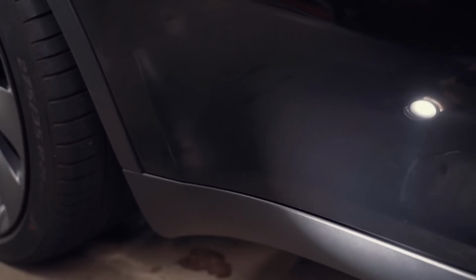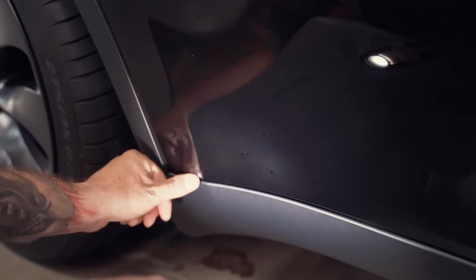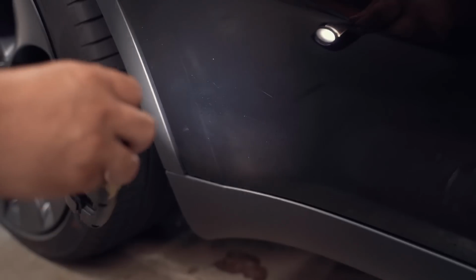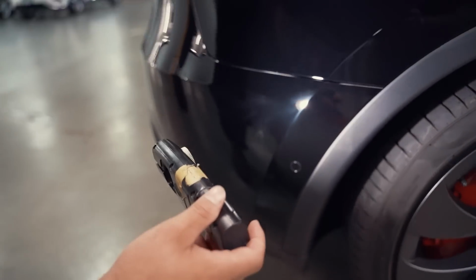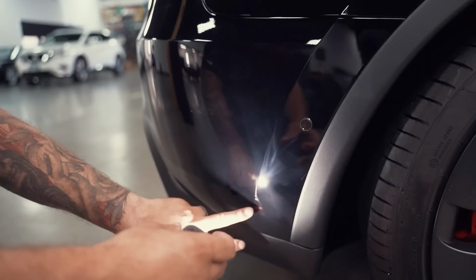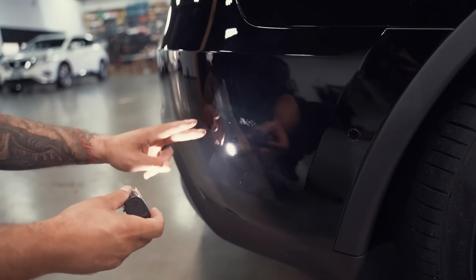That's overspray. That's the first sign of something that's been repainted, and we're like, all right, why is there overspray on this car? One spot of overspray. This is the back rear passenger side door. And we keep on going. Come back down here. All right, take a look at this bumper. So this bumper was obviously buffed, probably by this service center. And you can see some overspray here. You can see the hard line right there. Must have been a tape line right there for overspray.